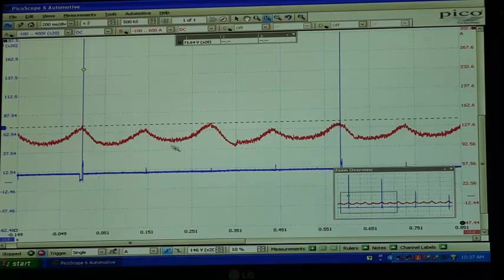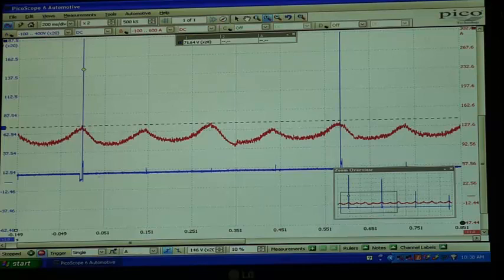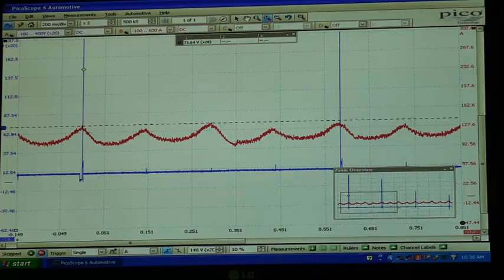I now know where to concentrate on this leak. I know we've got a bad combustion leak because we saw the water coming out, and I've got two very low compression figures on the two middle cylinders. Not saying that one and four aren't down a little bit — we could do a manual compression test later. But the head has to come off at least, and we'll have to look further into this motor. I wanted to show you how simple it is to do this and how beneficial it is to have the knowledge to use modern technology. I find very few mechanics these days take on some of this equipment, and they really do need to think about it.